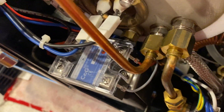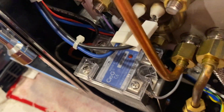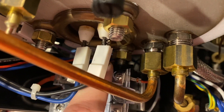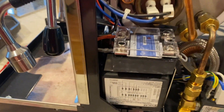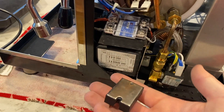The shrink wrap I have wouldn't have fit over the connector anyway — I would have had to strip these. Clearance is super tight here. I should be able to get the cowling on still. The new relay is touching the boiler over here, so I put a little piece of tape between the two just to keep them separated. I'm going to order the one from China and replace this because this one is just too big in every dimension and it's not properly heat sunk. My assumption is it's actually going to last just as long — if not less — as the original one.